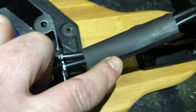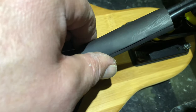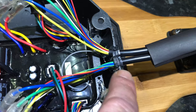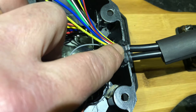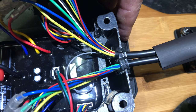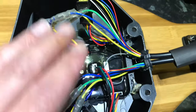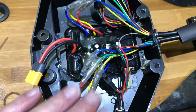So I managed to get the grommets back on here - I had to make a Frankenstein's creation out of two pieces of the shrink wrap that I had, literally cutting two pieces and gluing them together so I've got a wider diameter. It would be really useful if all this is already done by Welgo. Just so you notice, the slits on these grommets that I had to cut are still there. I've tried to make it so that the slit is uppermost, which means that when it goes on the board it will be against the board and not facing downwards where it might get splashed - not that I ride this in the rain ever at all. Make sure that the cables are nice and flat and definitely tightly connected the right way. I haven't got any shrink wrap to go over these, so I'm just hoping that's going to be okay.